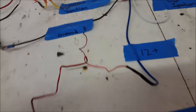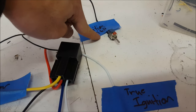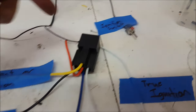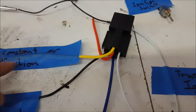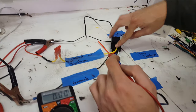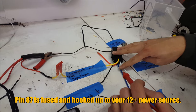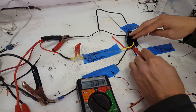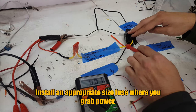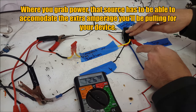This is the stuff I show high school kids on how to wire up a circuit. So we have this relay here, like I showed you on the firewall of the truck. This is going to emulate our ignition switch — that would be the ignition switch at the tumbler where you put your key in. Here we begin to start diverting power. This is the main power — either constant or true ignition. Then we have ground, then true ignition again, and then the 12-volt output line to the fuel pump. We're going to start at pin 87 — the objective is to make the yellow and the blue connect through the switch, meaning we're connecting pin 87 to pin 30. On the multimeter, we have it on constant ignition, and you can see right now we're at 12.6 volts — so we have voltage going down the line.